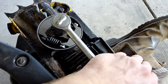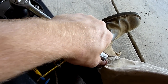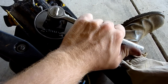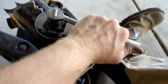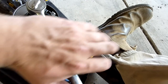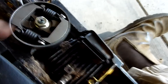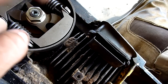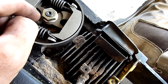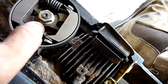You don't need that much torque — just kind of hold it with your foot and use a 17 millimeter socket to tighten it up. You'll get a little flex from the rope. Don't tighten it so tight that you break it — if you over-tighten it, or take it off the wrong way, this piece will break in half because it's tapered, and it'll smash your needle bearing.